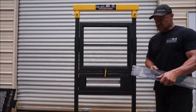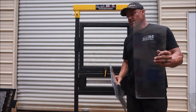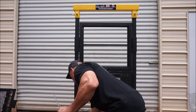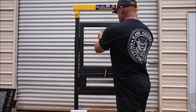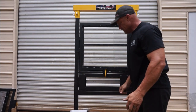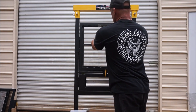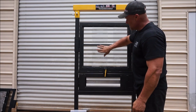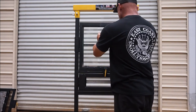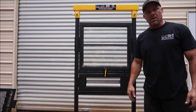Now that we've broken out all three panes, let's talk about the replacement of each window pane. Each of the window pieces on the ends have a beveled corner to go around the weld. Always start with each end piece and then replace the middle one. Start in the middle of the pane, flex it, put it inside the slot, and slide it over. Do the same for the other beveled side — each corner is beveled. Last but not least is the center piece, which does not have any bevels on the corners. Slide it in place and you're ready for the next set.